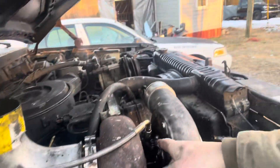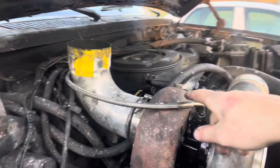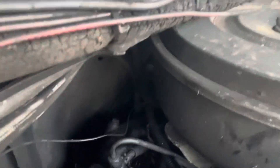We do have a small oil leak, which I'm sure you're all commenting about. Don't worry — these motors leak about a gallon of oil a day anyway, so it'll get fixed eventually. The oil lines are from Amazon. I ran it back to the oil pressure sensor in the back, teed off of that, and ran it to the turbo. The oil drain line is a half-inch fitting, so I went to Lowe's and got a bunch of half-inch fittings.